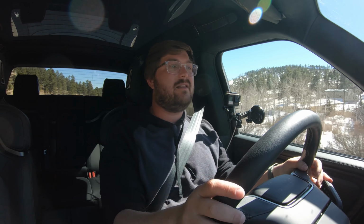Wow. So we've driven 7 miles pretty hard, and we've averaged 0.7 miles per kilowatt hour. We used 10 kilowatt hours to go 7 miles. So definitely, if you're going to shred this thing, expect under 1 mile per kilowatt hour, especially on a hill climb. But when you factor in the round trip, you'll probably at least get to the bottom with the same state of charge that you left with. In my experience, you don't really gain too much on the way down. It's still a heavy vehicle with rolling resistance.